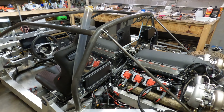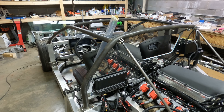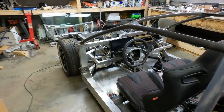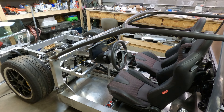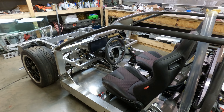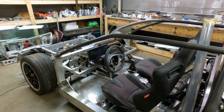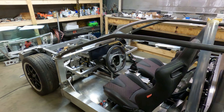16 circuits won't be enough to do the entire car, but it'll do most of it. What I can do is use one of those output circuits to power a small fuse box in the front of the car for the remaining circuits. I also need to figure out exactly what I'm doing for an ignition switch, because the first notch turns on accessories and powers up some circuits, and then when you crank the car it powers up more circuits. So I need to plan which circuits are going to be on ACC and which ones are going to be on a full start.